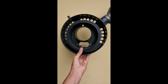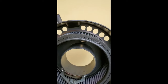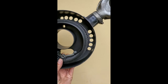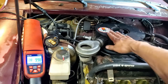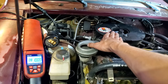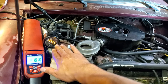I've gone ahead and swiss-cheesed the air box as you can see. The air filter still filters the air, but I've increased the housing's ability to breathe. This should correct the high-speed enrichment problem. Now let's repeat the test — before, between 4,000 and 6,000 RPM it was going into the 0.8s, but without the air filter on it was staying in the 0.95–0.96 range, so hopefully we're back there at high RPM.